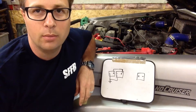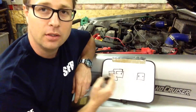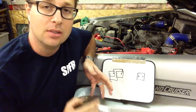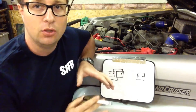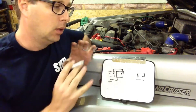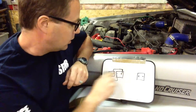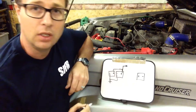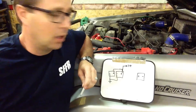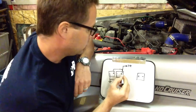So what's going on? We've got two batteries in the front, one battery in the back, fuses and isolators. The two batteries in the front are acting as one with a larger capacity. When you put two batteries in parallel, you get double the capacity. When you put two batteries in series, you get double the voltage. This is a 12 volt truck - it has two batteries in parallel for double the capacity. A lot of 70 series will have two batteries in series to give you 24 volt, but not the case with my truck. In the front the two batteries are tied together - positive to positive, negative to negative, negative to ground and positive feeding the truck. My battery at the back powers the fridge, powers my external camping lights, and it's where the solar hooks in - and we've got an isolator.